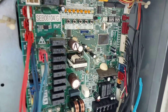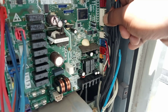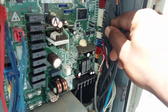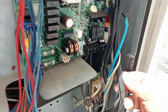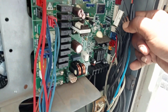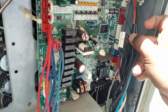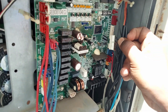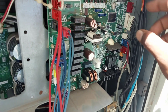We go to check the PC board where all the thermistors and connecting pins are located. On this unit, there are five thermistors total: R12, R22, R42, R52, and R62.